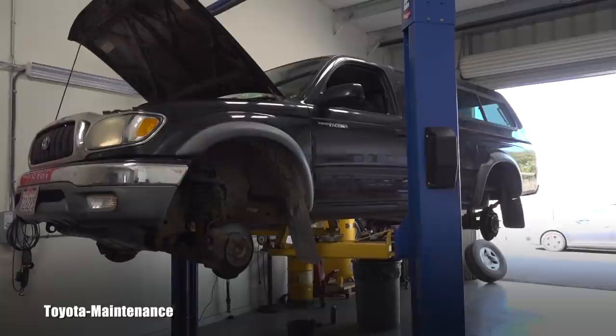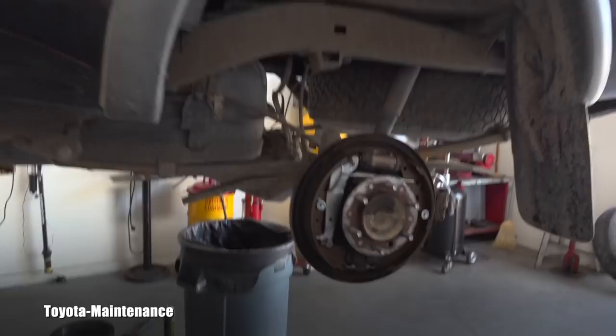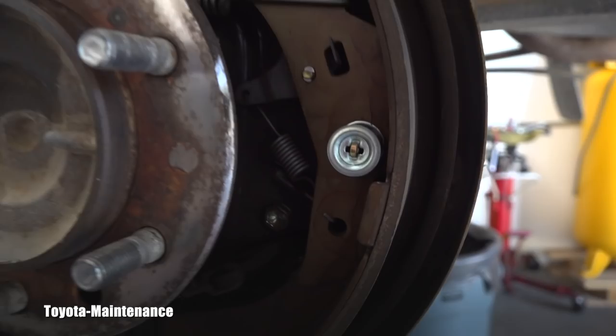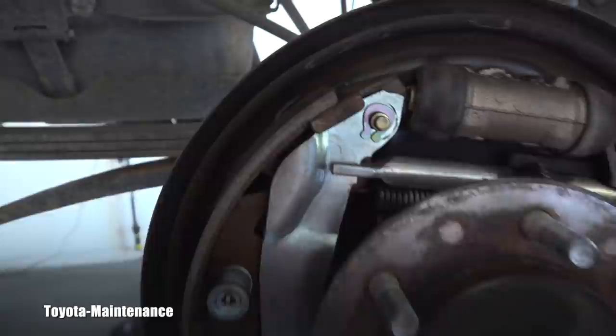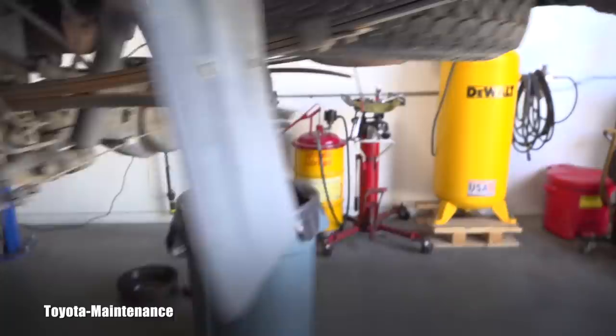Let's start on the rear. You're probably familiar with these eleven-and-a-half inch drums — these are the big drum version. The smaller version is 10 inch; you're probably familiar with that six-lug setup, it's pretty common. The rear brake shoe will be a nice four millimeters when you open it and clean it with brake cleaner, but the front shoe towards the front will suddenly, in this area, be only two millimeters.